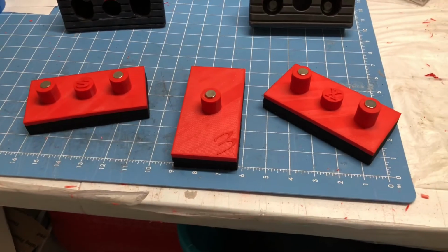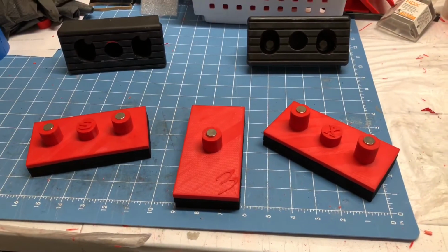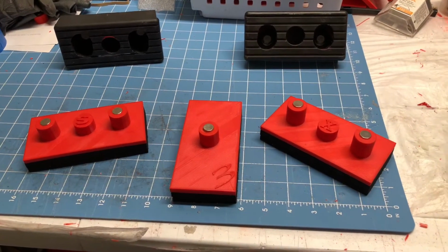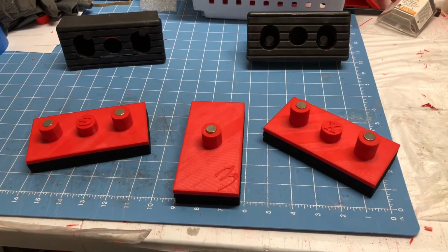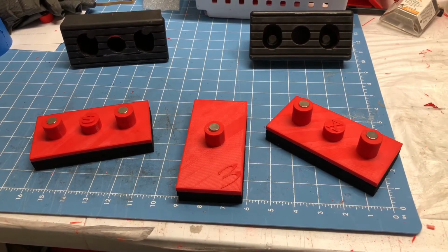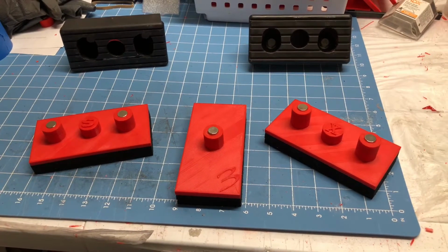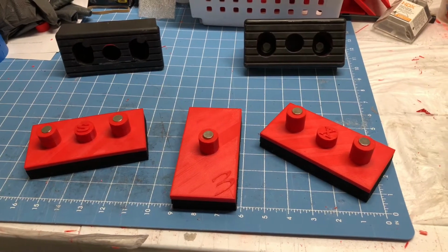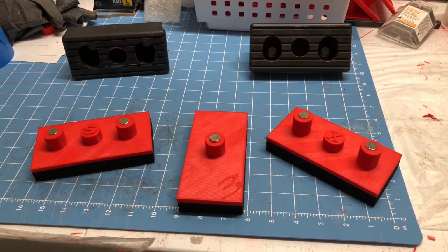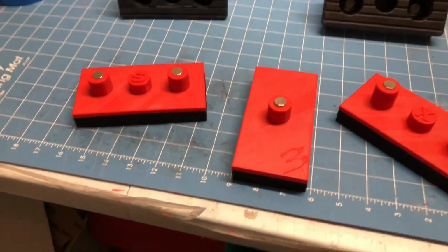And when you lift this vehicle, if it's not on a flat surface, or say the rollers on your floor jack get caught on a pebble, even I've seen as little as that, it can keep the floor jack from rolling forward, which will cause the floor jack to itself slide rearwards as the vehicle's lifting. So you have to be super careful.